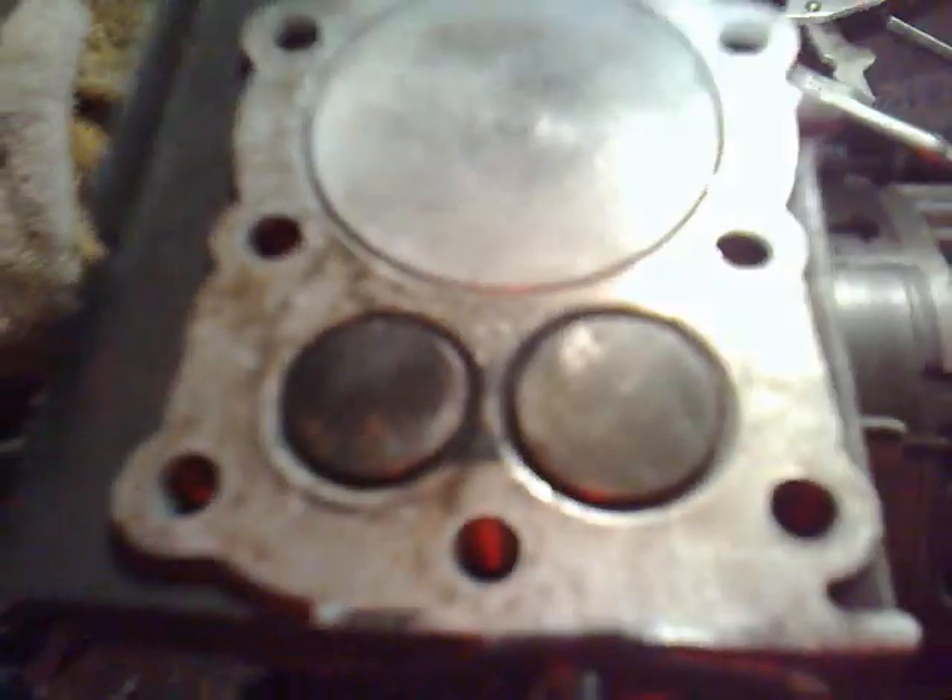So what I did was I ground the cam down a little bit on the exhaust and the intake. When it was on its downstroke, I shortened the valve duration just a bit. So now this is top dead center.